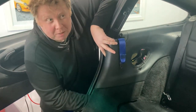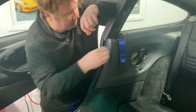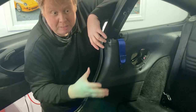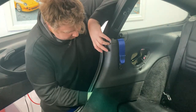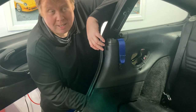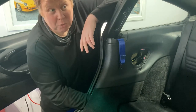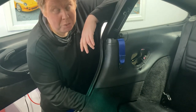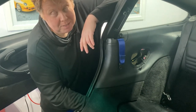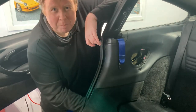And if you're putting on the seat belts and you realize that you can't actually pull this up and it feels like it's trapped, that's just because you don't have the seat belt sitting upright enough. It notices tilt, and if it tilts too much, then it locks the seat belt in place. Of course, you know, assuming that you're driving off the road, which is not the case obviously here. But that sort of stumped me at first.